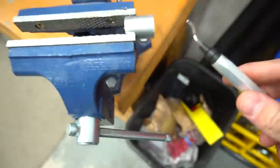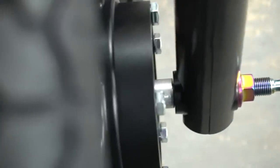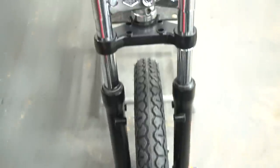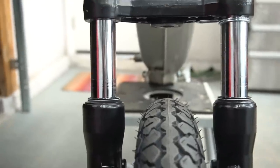Currently making some spacers for the front wheel — just a piece of aluminum, 12mm, cut down to the right size, then used a deburring tool to clean up the edges. I cut one spacer but that's all the aluminum I had. Luckily two fit perfectly. I can tighten it down and we've got the wheel perfectly centered with exactly the right amount of spacers right down the center.